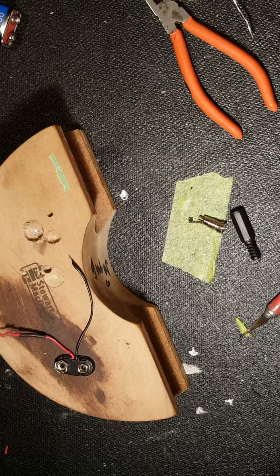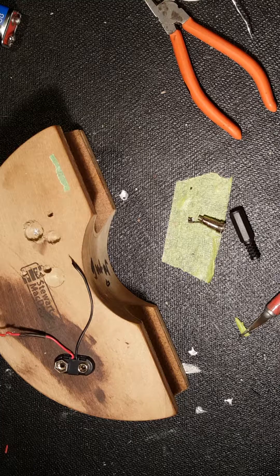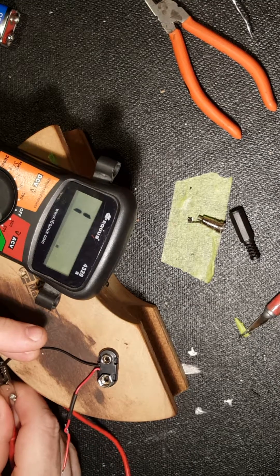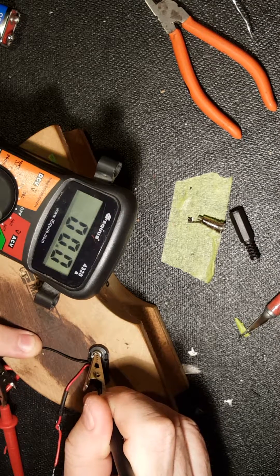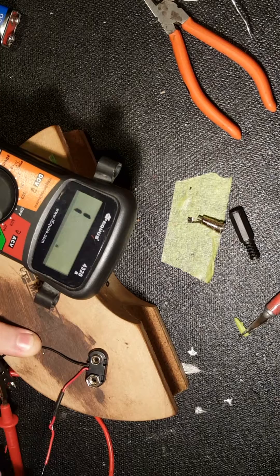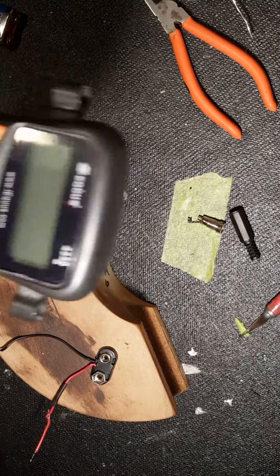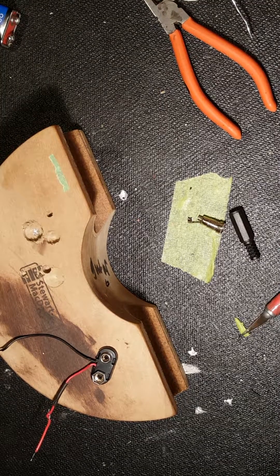Just to be on the safe side, if you have a tester or access to one, it helps — to do a continuity check. I'll clip this onto the black wire and touch the small terminal. Here we see we get continuity. I don't get anything if I touch the red, but I do on that one. So now we've determined that this wire and this terminal are negative. It's a great little gadget, costs about 10 bucks — well worth it. Any hardware store will have them.